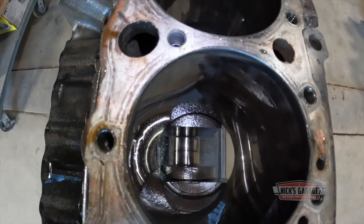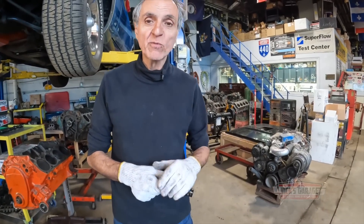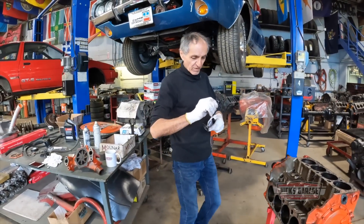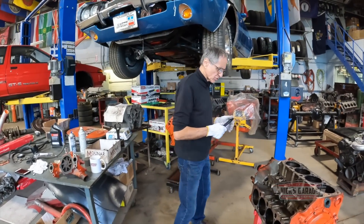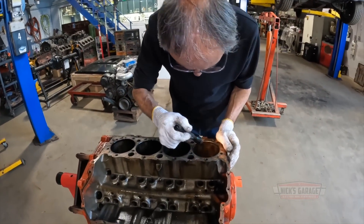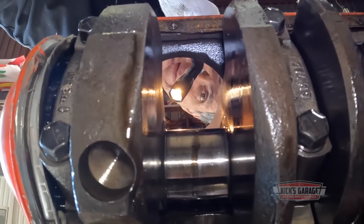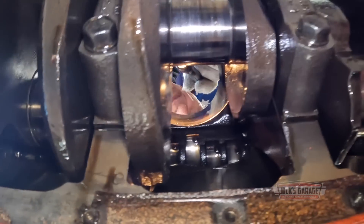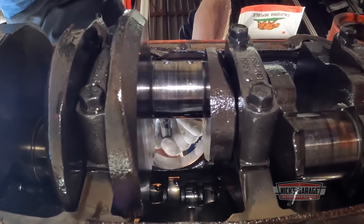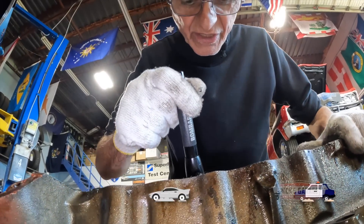To determine a cylinder crack, you've got to freeze the cylinder. But I'm not equipped here to freeze the cylinder, so I'm just going to take a visual look and see if we can see anything. It's going to be hard to say — it could be a hairline crack. When it gets hot, the crack opens up and then bleeds off into the combustion chamber and gets blown out through the exhaust. From what I see, I really don't know — it's hard to say.